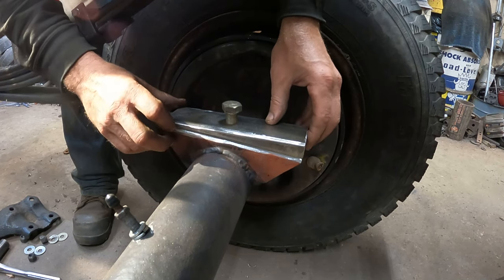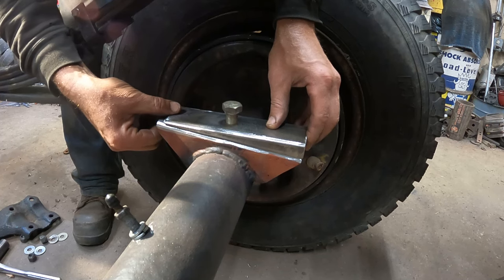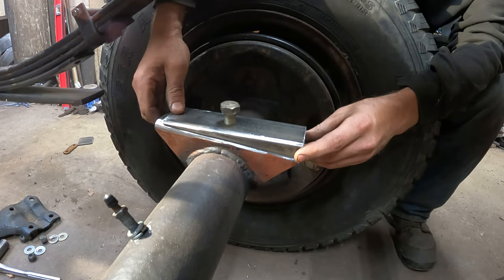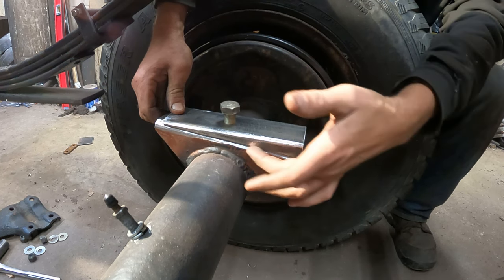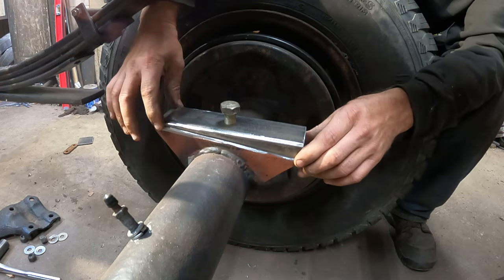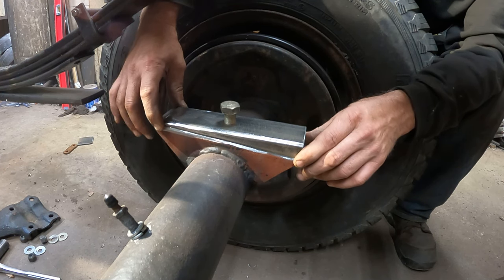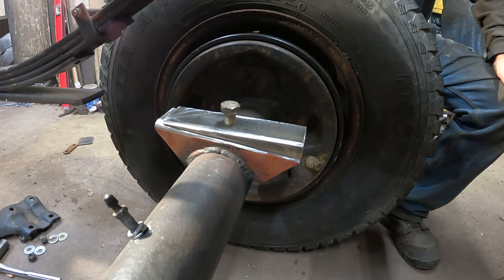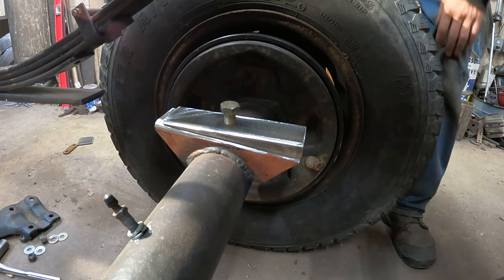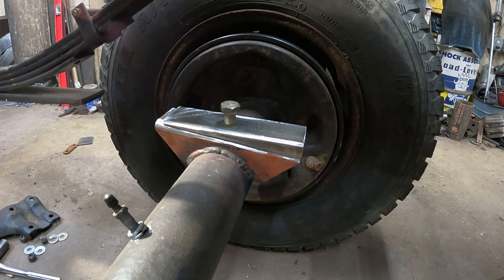This sits flat on the back here. I left it a half inch short, and it's giving me a nice place to weld but also a nice place to clamp. I'll just get a clamp here and clamp the back of it, get this lined up the best we can. Tack it in each corner. There's a nice bevel here from how the original pad was rolled — gives me nice penetration to weld on. We're just going to tack four corners, then roll the rear end back under the truck and set it down. If we can get within like a half a degree, that digital gauge is pretty sensitive. The transmission is 2.2 degrees, if this is like 2.5, that's going to be way more than good enough. Let me get the welder out and tack these suckers on there.